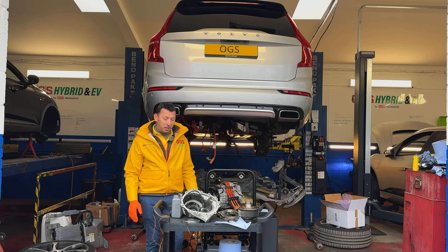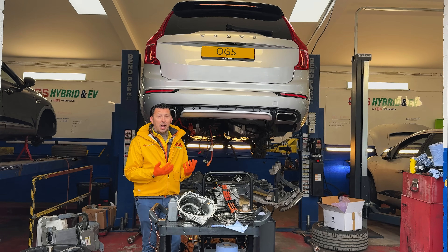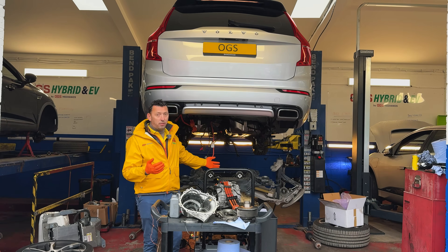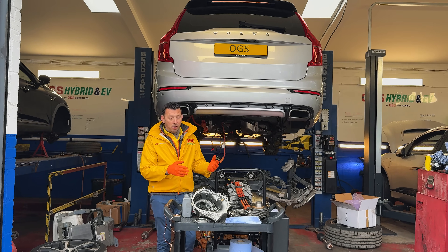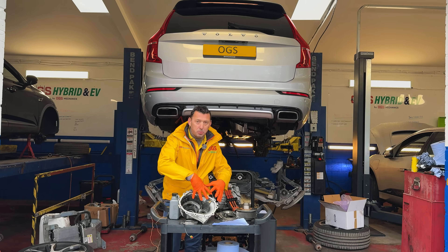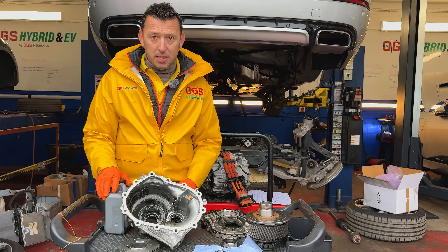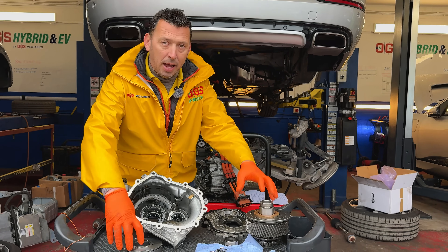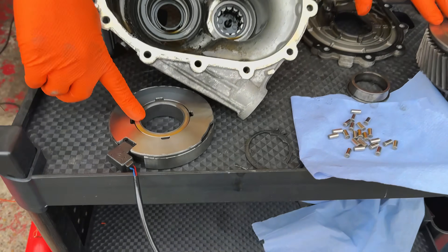Let's go through it because it's going to be quite interesting to understand how it operates. The electric drive is the motor — it puts the power out — and it's down to this mechanism here to transfer it to the wheels. It has a normal diff in here, and then a coupling mechanism in here. That's an electromagnet.